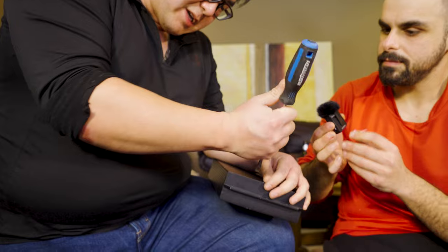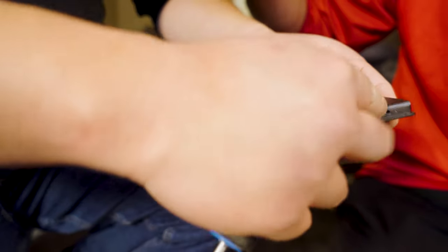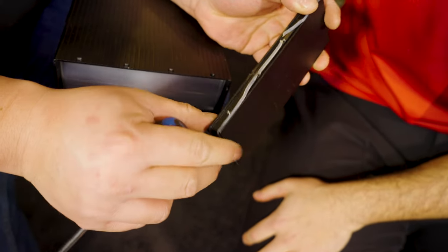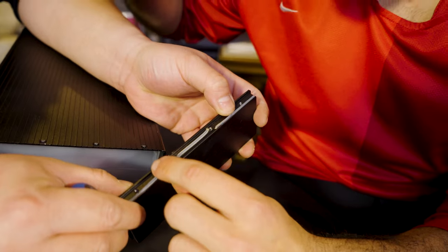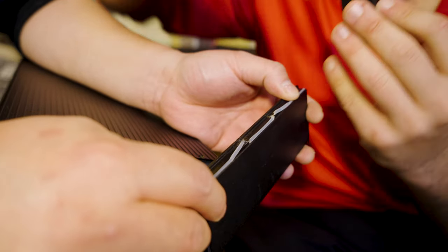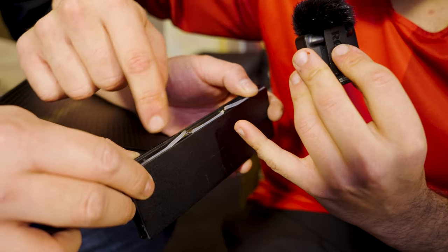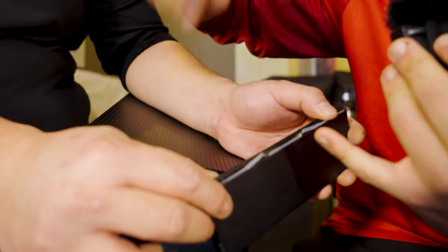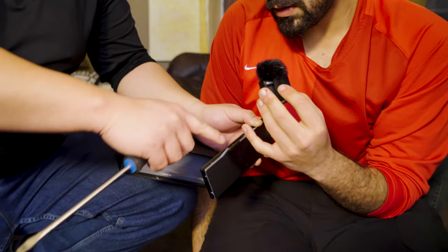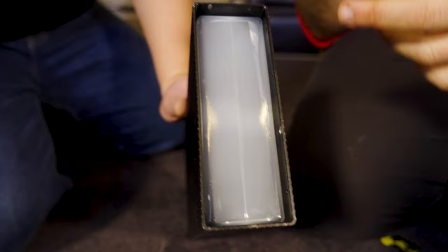Let's check the battery case waterproofing. There is some silicone here — actually it's an O-ring. The O-ring appears busted on this side; you can see the deformation where the screw hole is, where it may have bulged out. It's unclear if the holes were tapped correctly or what torque was used, but it caused the O-ring to nick right at the screw holes. Could have been a lack of grease when installed. The good news is it still looks pretty sealed overall.